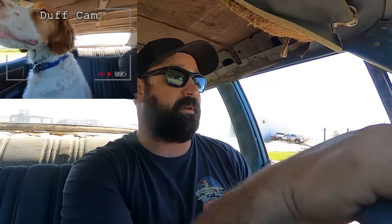This thing runs good. Tranny is nice and tight. I noticed that it is leaking a little around the old dipstick because there's two different style of dipstick seals, and of course our transmission and the dipstick had varying seals, and we used seals also, so that probably needs to be addressed.